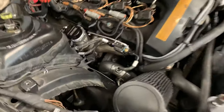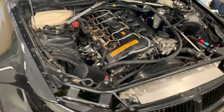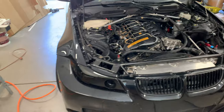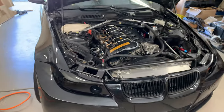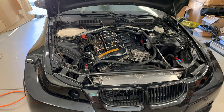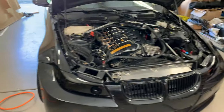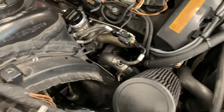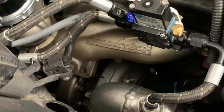We've got the turbo down here. It's a bottom mount, so there's not a ton to see, but that was intentionally done as part of the packaging. You'll see a lot of N54 guys throw the big top mount up here, which looks great and is really fun, but it makes it really hard to service the wastegate. The wastegate is really easy to get to right here. And on top of that, it actually puts the weight down lower — you want your center of gravity to be low, not all the way up here. So any chance to put it down there, we put it down there. It being a bottom mount, it's definitely a tight fit.